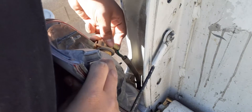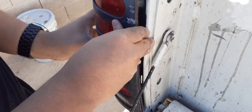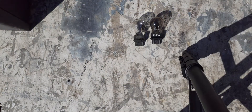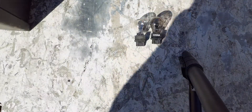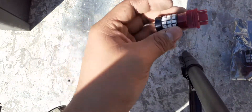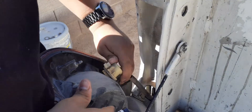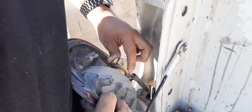Set that aside — out with the old and in with the new. These are LEDs, so we're gonna replace these incandescent bulbs with LEDs. We're gonna put one on each end, starting with the left side then going to the right. We'll test it and switch polarity if needed. So with this tail light, open it, then it's just a twist and lock.